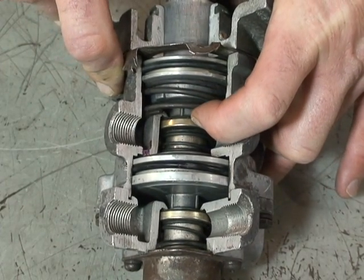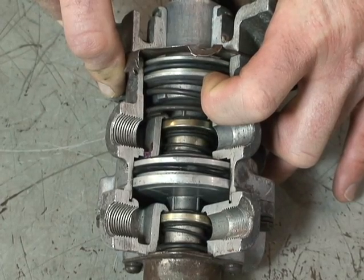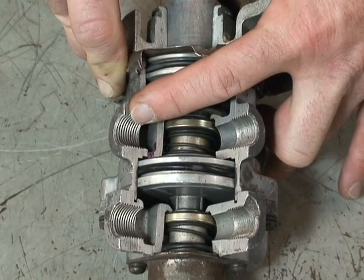Unbalanced supply air comes from the tank, reacts against the piston, moves it up slightly, and you go into a state of balance or hold. And that's delivered on to our service brakes on the rear axle.